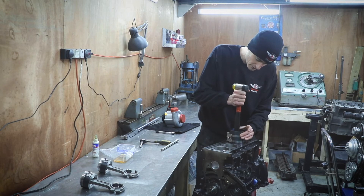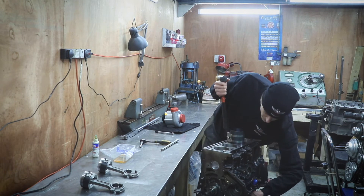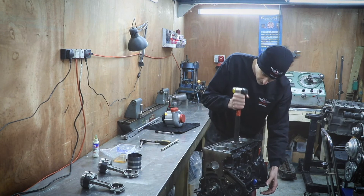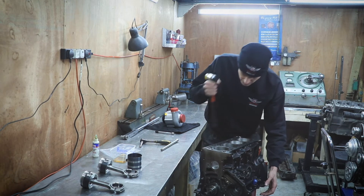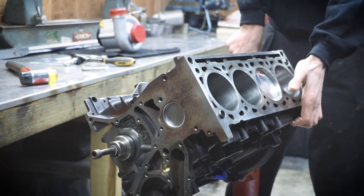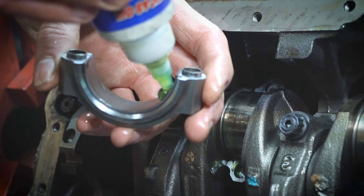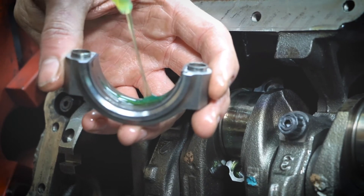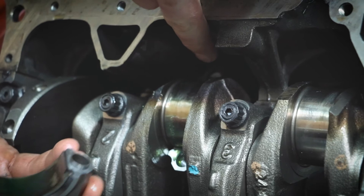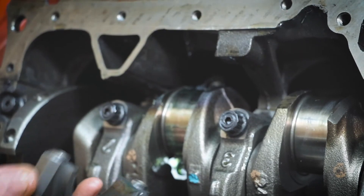Make sure it's reasonably lined up and then you can just knock it gently in with a hammer. It might tighten up a little when you get to the rings. Check it's not contacting the crankshaft. Now that it's in, you can knock that further down. Then rotate the engine so you can see the bottom of the con rod. Put some more engine assembly lube on — it's just like a really thick oil; you can see as I take the container away it's incredibly stringy. Make sure it's assembled as it came apart — this has the tang here and this has the tang there; those go next to each other to stop the rotation of the bearing.